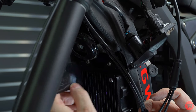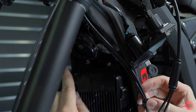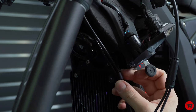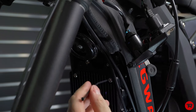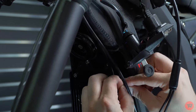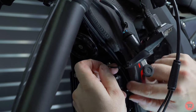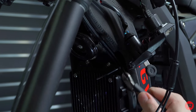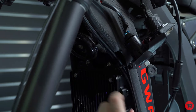So this little plastic piece could be used, but the bolts that come with the actual Segway / Surron aren't the right thread pattern. So what I'm gonna do, instead of running this little wire clip, is just put a zip tie on it through that hole. All right, so you got a little tiny zip tie. We're gonna go through that hole and back out. Once you have it out, go ahead and go around the wires. Pull the zip tie through. Now you don't need to go tight on the zip tie because you want them to still be able to freely move. And then always snip your zip ties. And then I always twist the heads away so you don't see the heads of them.